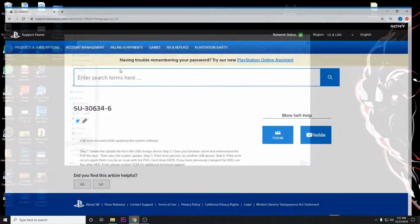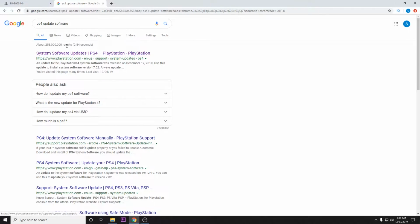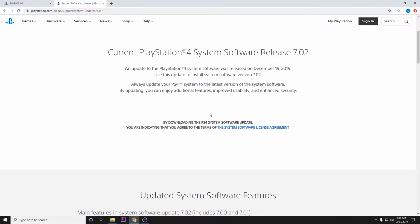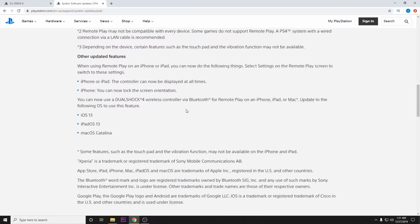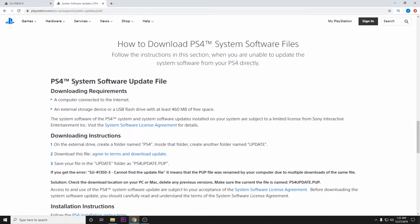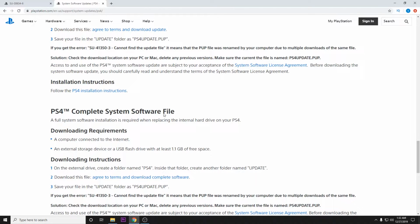So we're going to go ahead and go to the PlayStation website, and the web link to this website will be in the description of this video. Now, this is where a lot of people run into some issues, because Sony did a great job of laying out this page, but they did not do a good job of explaining there are actually 2 different downloads on this page. If you scroll down here, you can see there are system software files, and there's a software update file, and if you scroll down, there's a complete system software file.